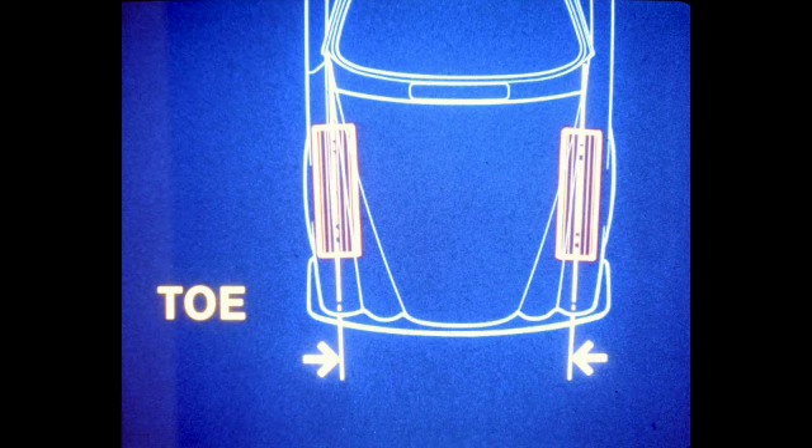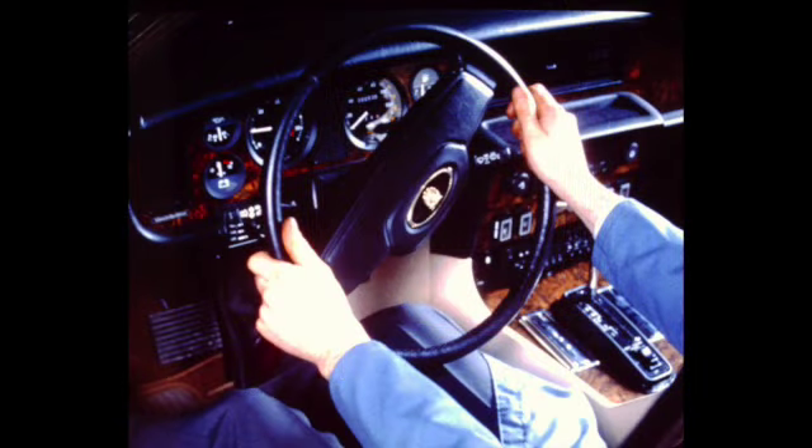If the steering wheel is not centered, correction should be made at the upper steering column universal joint. Disconnect at the upper connection only. Be sure the rack is centralized with the pin while making the adjustment. Check and adjust the front wheel toe setting to specification. Purge air from the system by turning the steering wheel from lock to lock. Do not increase effort when lock is reached. Keep a check on the fluid level and top up when the engine is turned off.